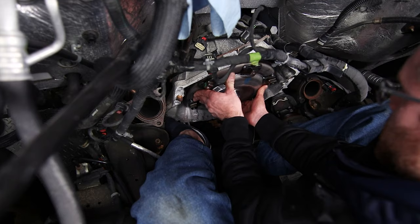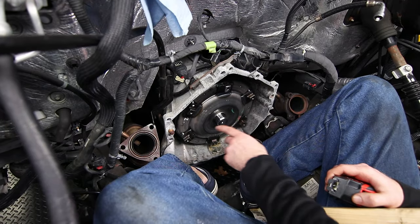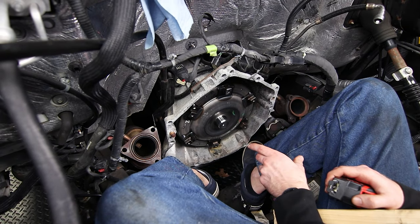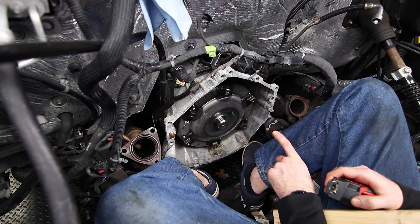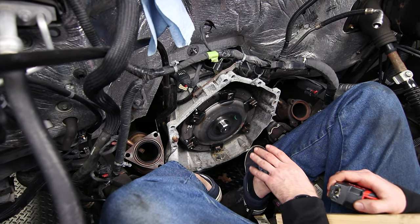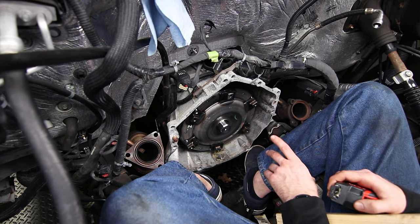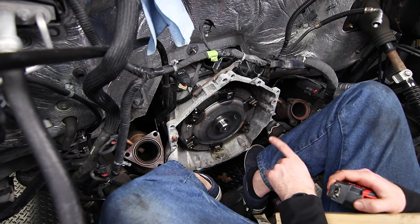Now we know that we need these about an inch back. We just checked the depth and we are fully seated — I had to slowly rotate it around while applying an inward force to get it to seat into those last two grooves. I did check with a shop that's installed a couple of these in 6L80 transmissions and they said there's no tuning of the transmission required — this is pretty much a bolt-on. If that ends up being different I will let you guys know in the description, but as far as I know there is no tuning required to make this work.